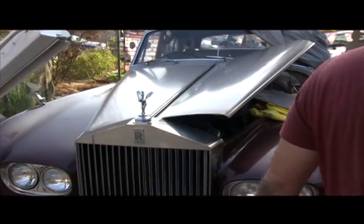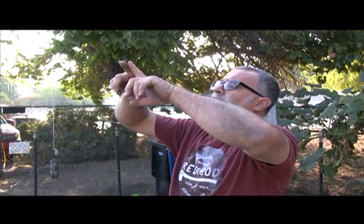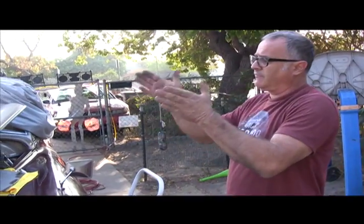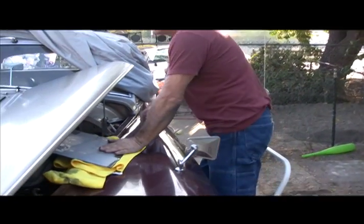So for big flat surfaces, you have to keep moving it — just to get it from all angles? Yeah, you always want to cross-reference. When you do hail damage, you're working from many different angles. The shop I worked in in Denver had essentially roll-up industrial doors, which creates almost a grid pattern, and you have light sources going from multiple directions. Just by moving your head back and forth, you can cross-reference and make sure you pick everything up. If you work everything from one direction and then walk around and look back, you can see all the trenches you've created because you're looking in the wrong direction. So you constantly have to go back and check it.